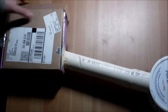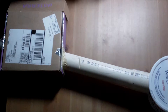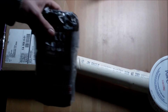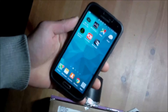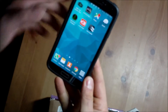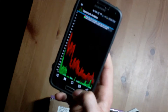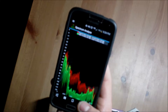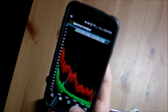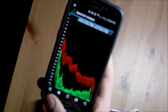This is a really popular style of muffler nowadays. We are going to test to see how coarse steel wool and fine steel wool will work to dampen the sound. We will be conducting the test by attaching this phone to the Bluetooth speaker, playing a frequency sweep from YouTube, and using an app called Spectrum Analyze to determine which frequency has the most amplitude — which is the loudest — and how the different packing affects the different frequencies.